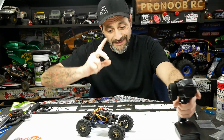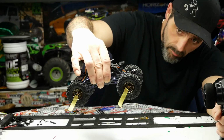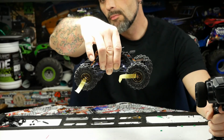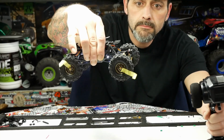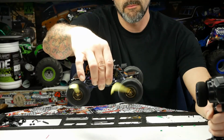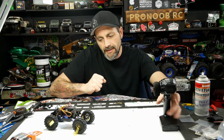Now remember, we did put the overdrive in it, so we do have 38% overdrive to the front. Let's actually get a piece of tape and mark that out. Hang on a second. It's turning more. It's not lined up anymore. So yeah, we got overdrive to the front now. That's pretty cool. That Hot Racing transmission was about 35 bucks Canadian. Overdrive is going to pull the front end a little quicker, pull the weight down low, helps.